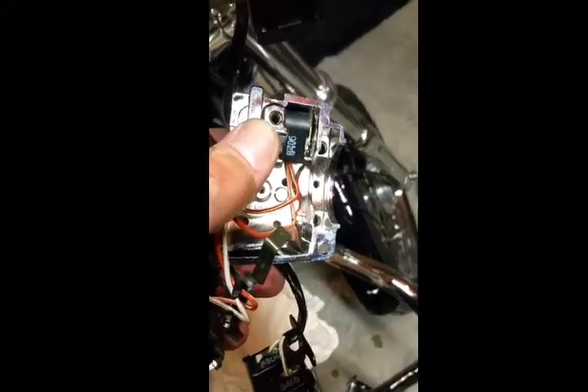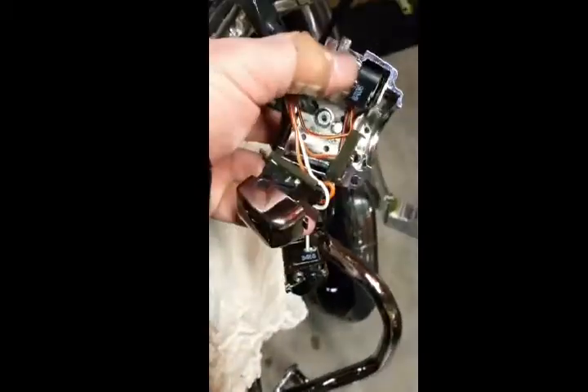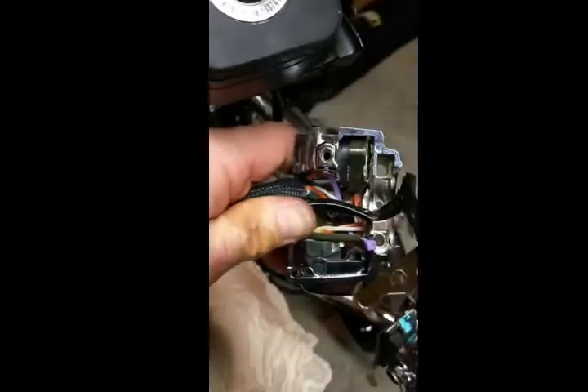I got this all wrapped back up. The better you wrap it, the less chance you've got of getting moisture in there. I put the switch back in as you can see, and remember that little brass clip — I put some adhesive on the back of it and slipped it back behind there. I got my caps back on. One other thing — don't forget before you put the screw in the bottom: put in a little zip tie in case you need it.